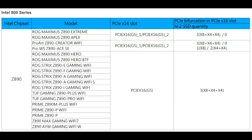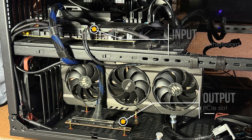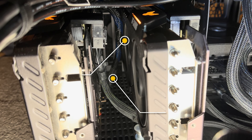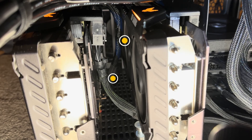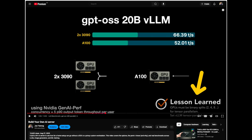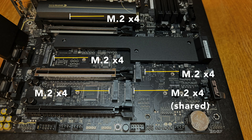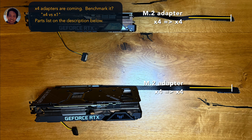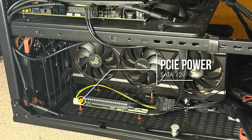Obviously in hindsight — luckily I was able to return it. Next, I tried the x16 extension cables. I measured and picked the length and even chose which side of the connector should exit. Then it arrived, the cable was a bit short, and the connector exited on the wrong side. This meant ugly bends and tight routing, all the way to an early morning rebuild session. My wife ended up holding the screws and the GPUs while I tried not to kink the cables. Then after the tensor parallelism test, I realized that I needed a 4th GPU. With bifurcation off the table, I tried M.2 PCIe adapters, which are cheaper. But the ones I got were x1, not x4 — so unless it explicitly says x4, assume it's not. The ProArts M.2 heat shield wouldn't close, so I moved the NVMe to another slot. Thermally, this works well. I can space the GPUs better at the bottom deck.